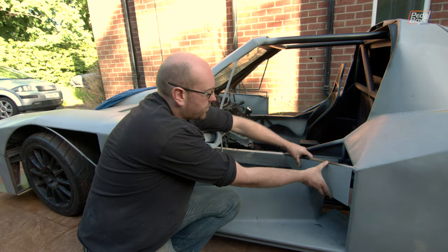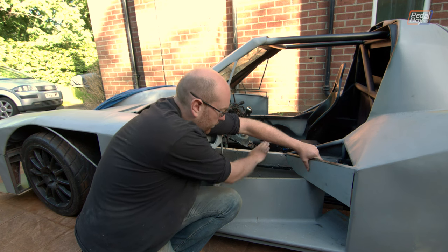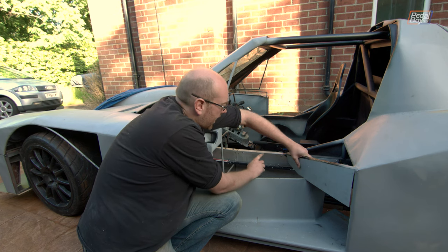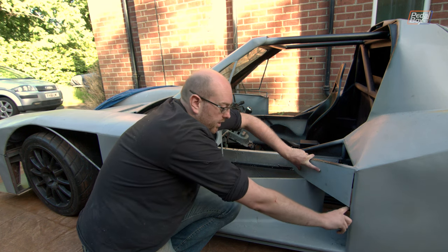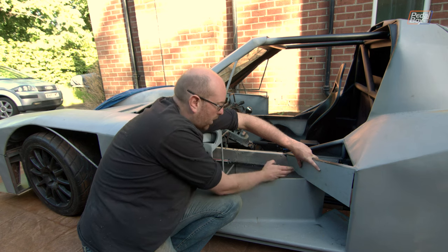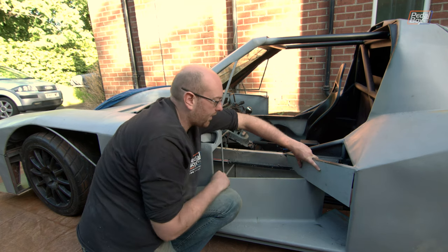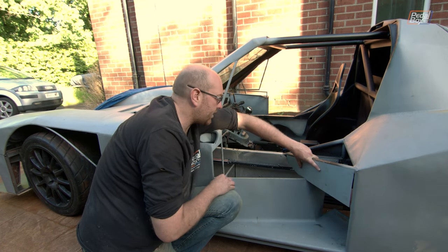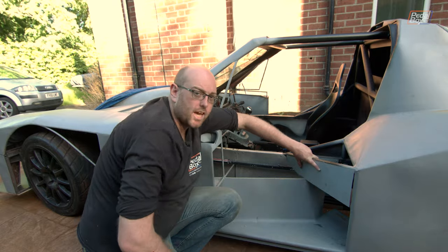We've got a couple of these ready - these are just going to get welded in across there and that will finish the rest of this section of the car leading in towards the inner chassis. We've trimmed a little bit away so we're not welding onto the ally sheet. We're going to have to roll this side under so it fits onto the upper cross beam of the inlet. We'll then close off the inner panel here and pop rivet that, and put an extra panel in to close off the back because we don't want this section to be open all the way into the vents at the back.